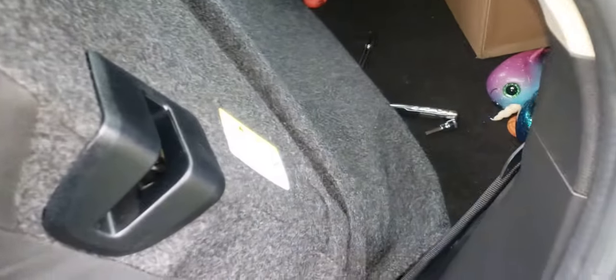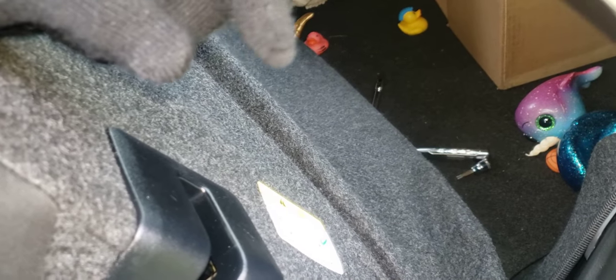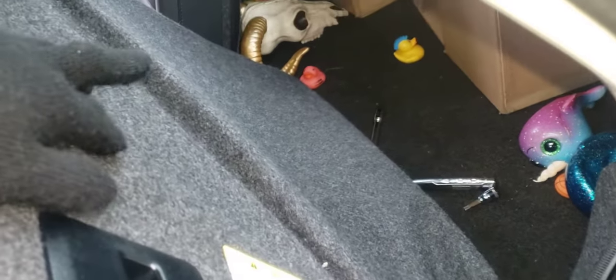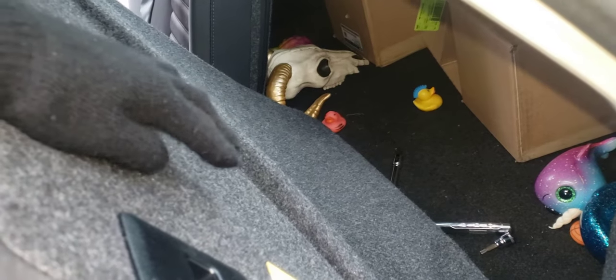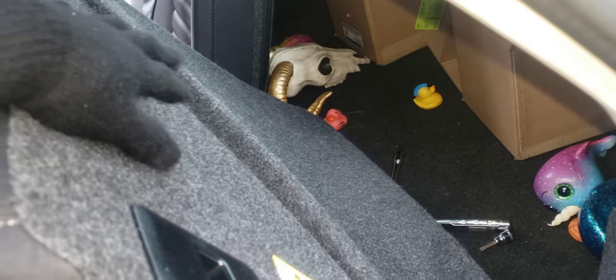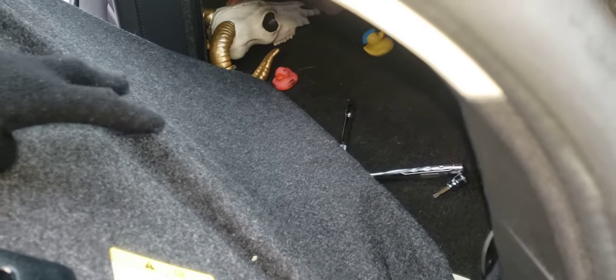What I had to do is take that back cover piece off. Basically I had to squeeze those two tabs together, then separate it. On the passenger side you'll have a zipper that's about towards the end of the seat — just unzip it all the way to the top corner. On the other side you can pull this back and you'll get a couple of hex screws for the armrest.